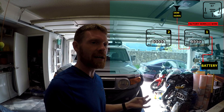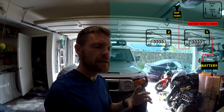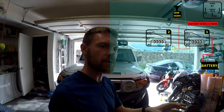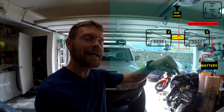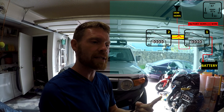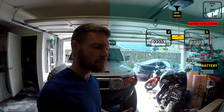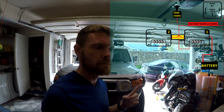The factory horn will still work whenever the vehicle key is turned off. You can use a four-pin or five-pin relay for the primary relay — they're basically the same, but a five-pin relay adds pin 87A, which connects directly to pin 30 until the relay is turned on. We'll use that and wire pin 87A directly to pin 30 of relay number two. This way, whenever you press your factory horn button, relay one engages and sends power to relay two.